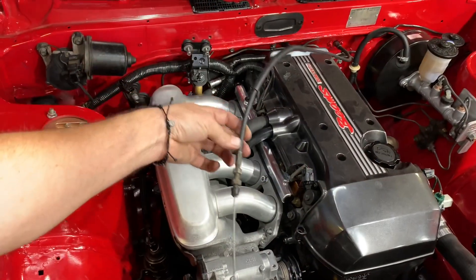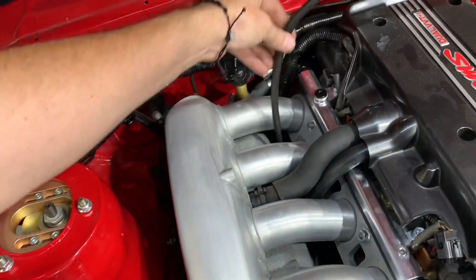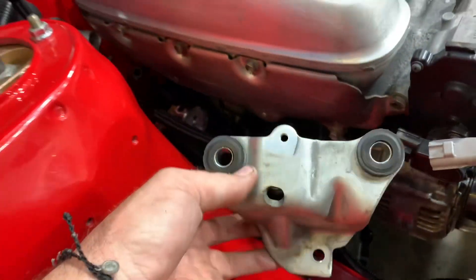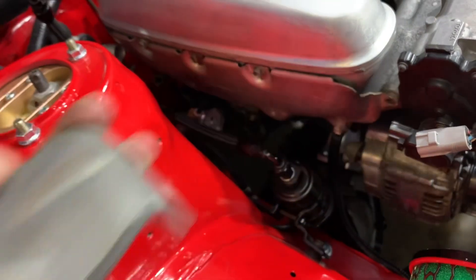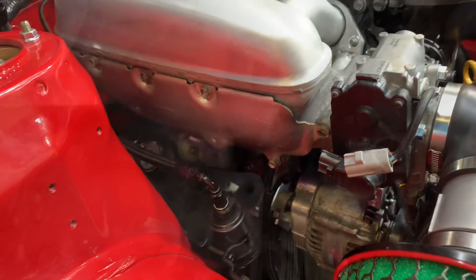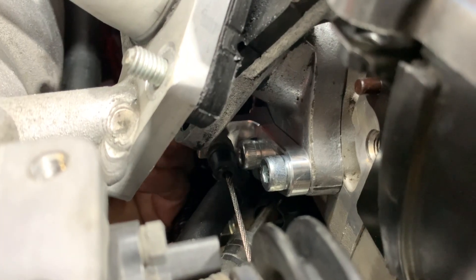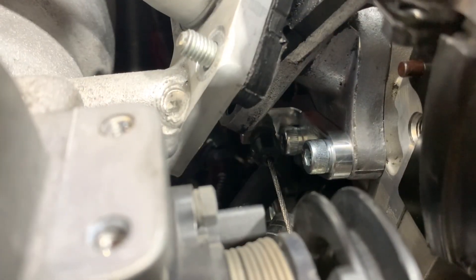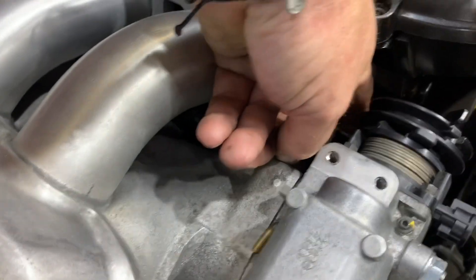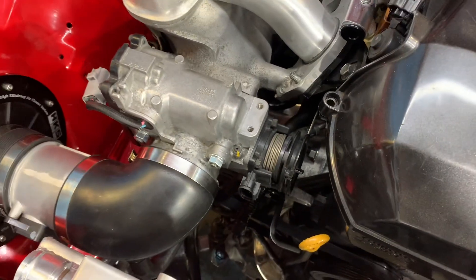The final install of the throttle cable has to be done after the intake manifold is on the engine. The cable slides between the number three and number four runners and routes underneath. You'll want to remove the intake manifold bracket to gain access to tighten the cable underneath. Start by attaching the end of the cable onto the throttle linkage on the throttle body, then pull the cable back to take some of the slack off and make sure it's guided onto the rotor correctly. Slide the cable onto the JSP bracket and tighten it down, making sure there is a little bit of play — if the cable is too tight, the throttle body will not close correctly. After install, verify that the throttle body functions normally.